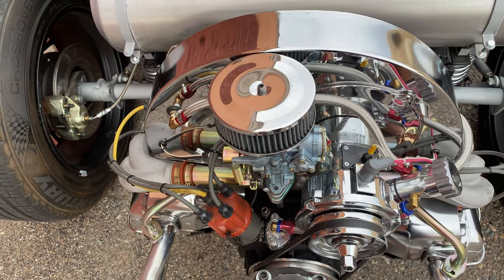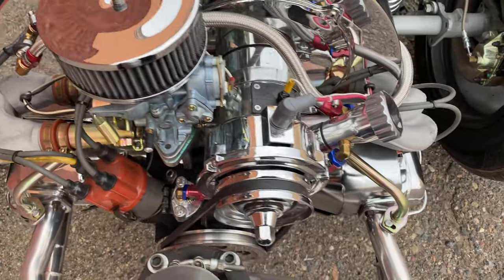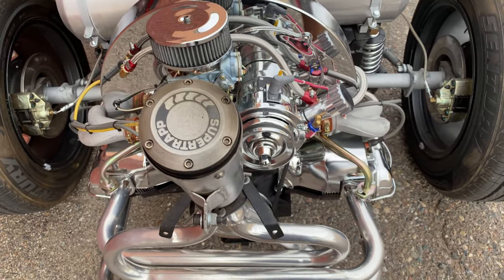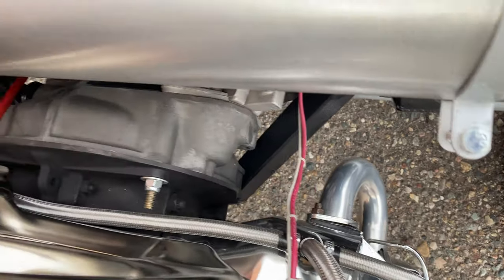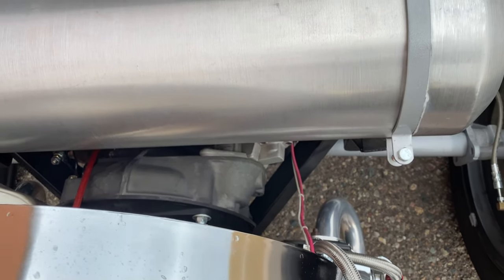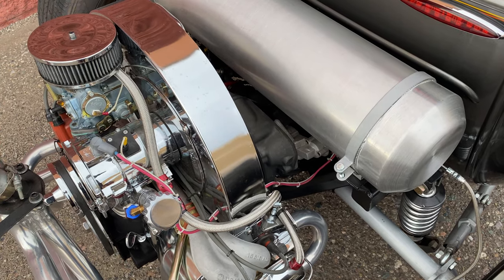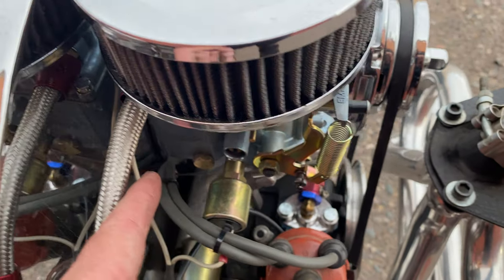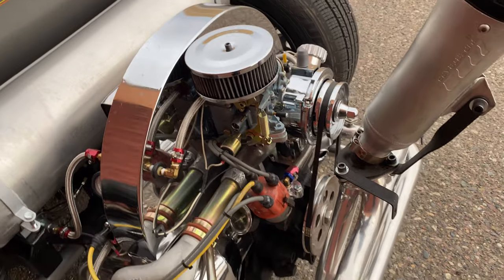You can put on dual carburetors, convert to fuel injection, add Volkswagen turbos, different heads and a cam — but this is meant to be super reliable. You turn the key and you take off. It's literally four bolts — disconnect your starter, two bolts top and bottom on each side, 17 millimeters. With two people you can pull this motor in about 12-13 minutes. By yourself it'll probably take about 30 minutes — just disconnect your fuel line to the carburetor, your throttle cable, your battery up front, and your coil wire.